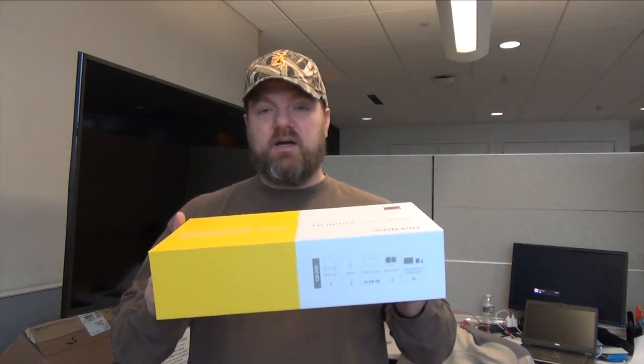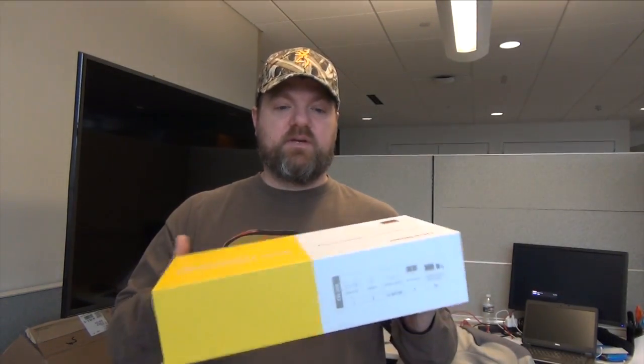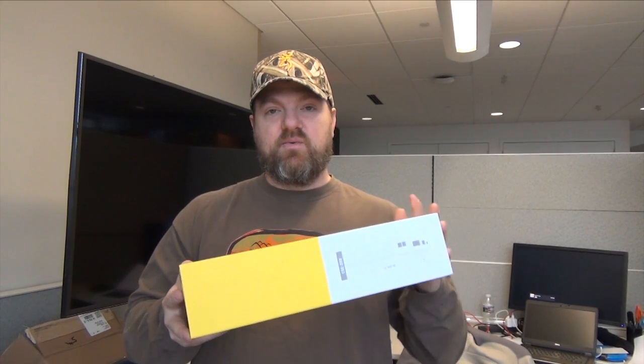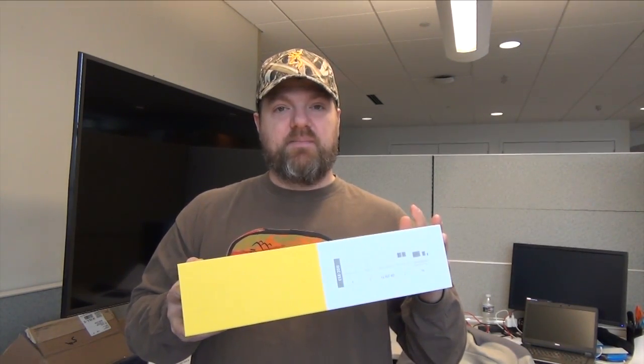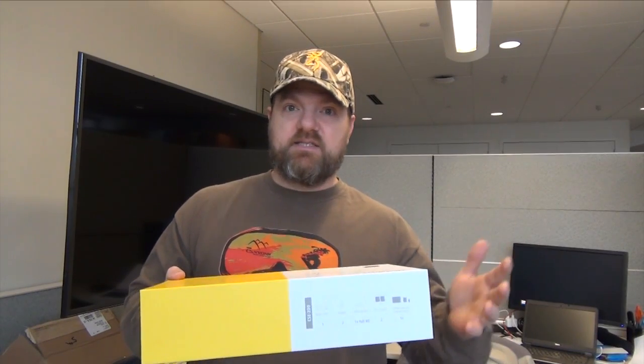These are really convenient and really easy to set up. It's similar to the Crestron AirMedia, however the Crestron AirMedia is behind your firewall, where this on the other hand is not. This sits in front of your firewall because this base unit is Wi-Fi, and the Wi-Fi connects to the dongles that you plug directly into your laptop, where on the Crestron you don't. You actually have to log onto the wireless network of the facility, and that has its pros and cons.